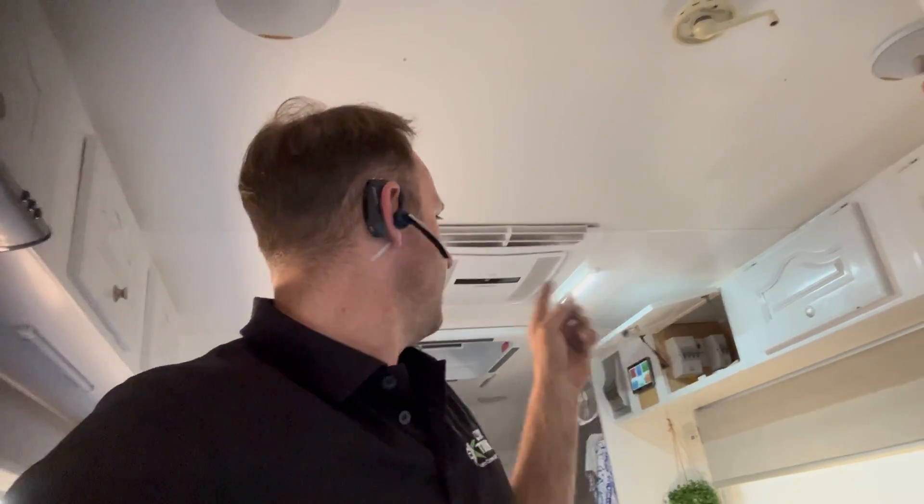In the form of solar, there are all Volta panels that were previously put on. There are three 200-watt panels along this side, another two on this side — so that's a thousand watts there. Then there are four 120-watt panels up the front and another one at the rear — big numbers. We split the solar systems up so all the 120s are on one 50-amp controller, the three 200s are on the other 50, and the other two 200s are on the 30-amp controller. This is going to put out some good numbers.